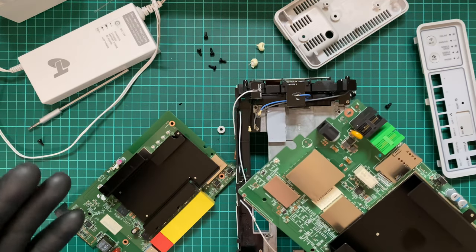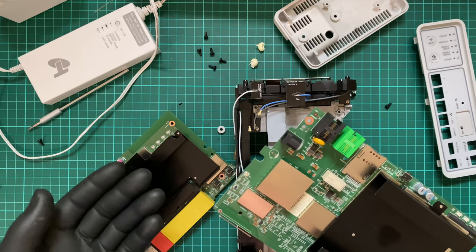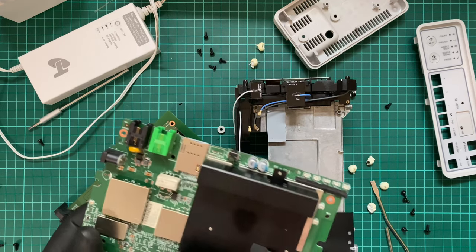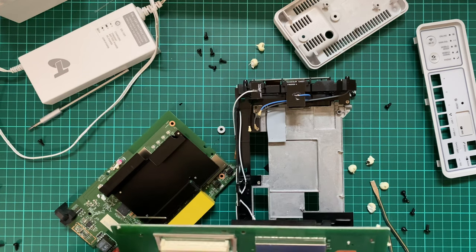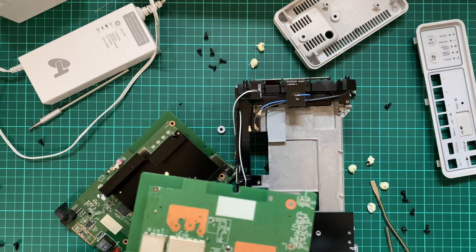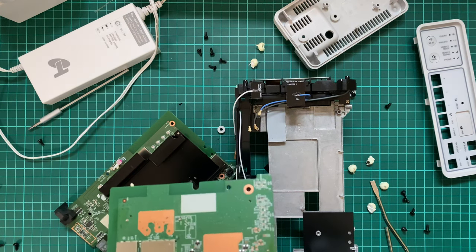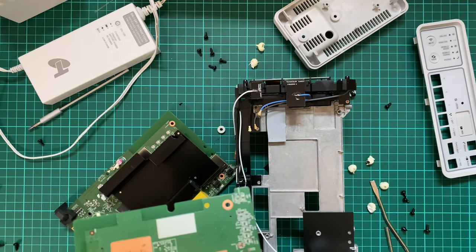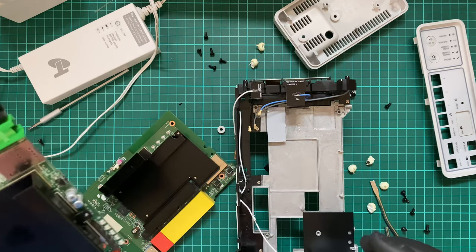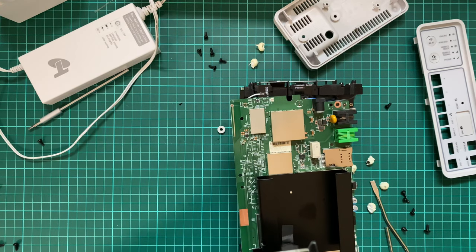Switches are managed devices that allow you to move data around, while a hub, well, network hub, it sends the data out on all ports, regardless of who it's supposed to go to. So, if I had the proper setup, what I'd be doing is figuring out which of these pins, sorry, I'd be looking at the voltage coming in, which is going to be here. So it seems to go this side to this pad, and that's probably just some sort of testing point. I'm guessing multiple pins must be used for power transfer from this side to this side. So you could definitely do an injection here, but where's the primary power?